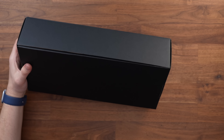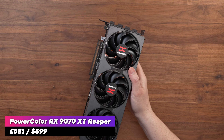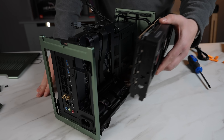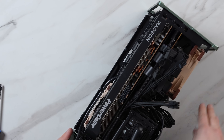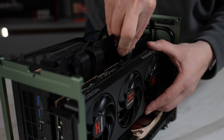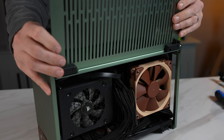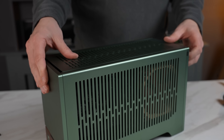We're going to be using an AMD graphics card today, and I'm going to be using the PowerColor Reaper 9070 XT. This has to be the most friendly small form factor card in the 9070 XT range, and it makes it very easy to work with in ITX builds. Just look how much room is left inside this Terra case once we've installed our Reaper card — this is great for airflow and acoustics. With that graphics card inserted into place, we're going to plug in our PCIe power connectors, then screw it down with the thumb screws provided. We then tidy away the last of the cables so that we can replace our side panels, pop on the top panel, and slot it back into place, locking it shut.